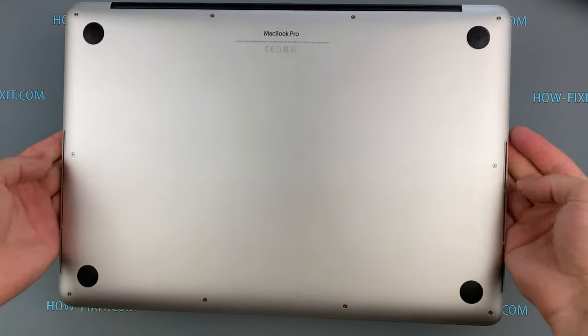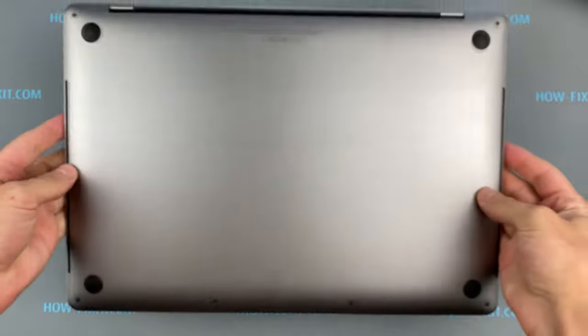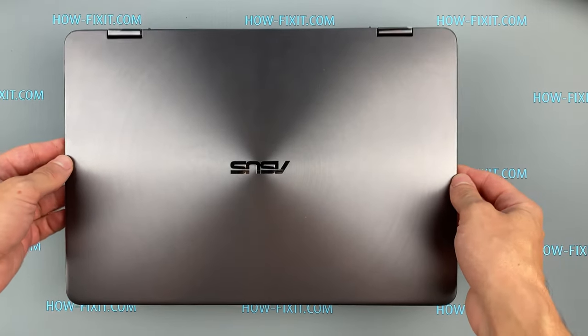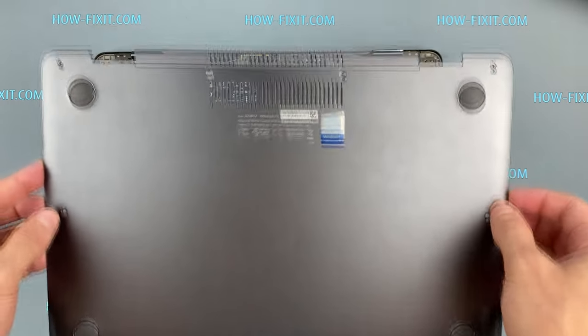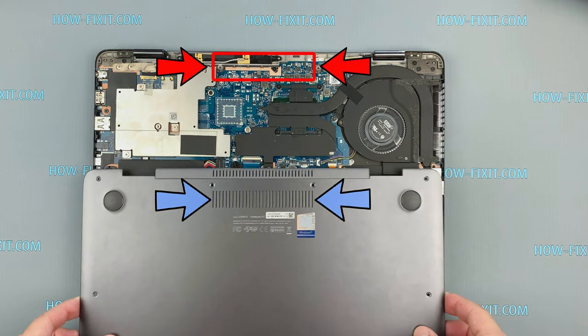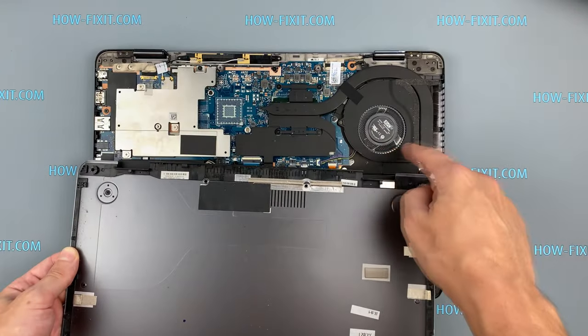It's the same with the Apple MacBook Pro and Apple MacBook Air — the bottom cover of these laptops is without ventilation grills. The best thing you can do is clean dust and replace thermal paste to reduce overheating. The next laptop is the Asus UX461 — a very interesting case where a cooling pad is not effective. You can see a ventilation grill on the bottom cover, but if you remove it, you'll see that this grill doesn't give direct access to blowing the cooling system. Before buying a cooling pad, make sure the air vents give direct access to the laptop cooling system.